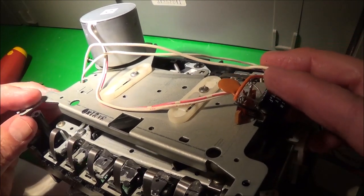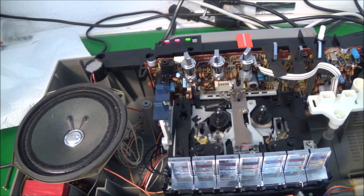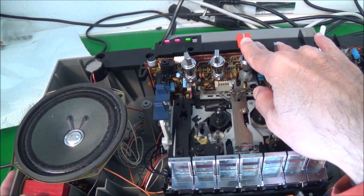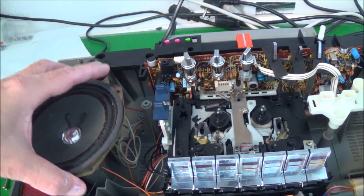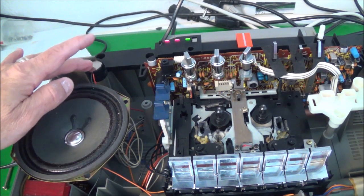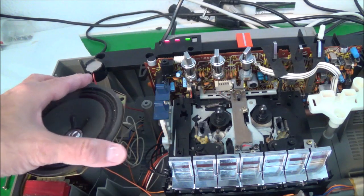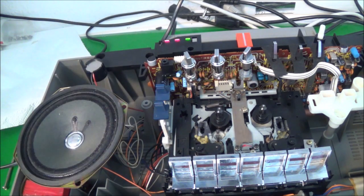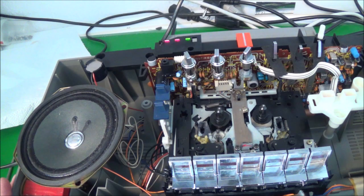We put the back plate on and make sure everything is lined up. This job is now finished - I'm not sure whether I'm going to do any extra videos on electrical or mechanical adjustments. When pushing the circuit board back in you'll hear it snap into place and see the connectors lined up flush with the housing. Also watch out for these tweeters here - these super cheap tweeters are connected to the woofers and if they fall out too hard you might rip the wire where it attaches to the tweeter, giving you another problem. Thanks for your patience and thanks for watching.